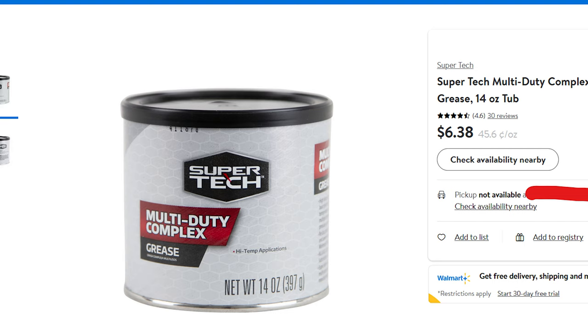A little bit of grease. It sounds weird, but if you're having a problem with a gasket staying — like the float bowl gasket — a little dab of grease on the gasket itself onto the metal will keep it from moving, and it won't cause any damage.